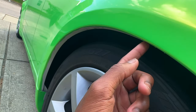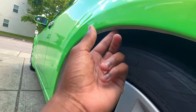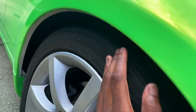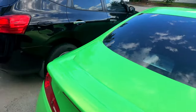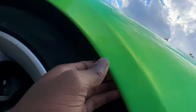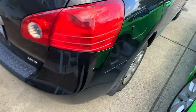Here's the little lip right here. Thankfully I didn't get the wrap all the way over here so it's not really affecting the wrap. We're just gonna be bending this in so it's flush with this part right here, and once that's bent in we shouldn't have any rubbing issues. I'm not too sure about the front — the fronts look like they're already pretty much rolled. I do have some fender liner in there but I'm not removing that, so the fronts are just gonna have to do.